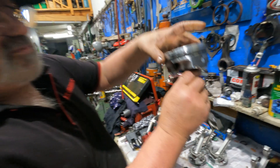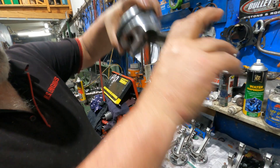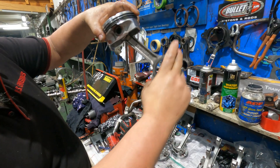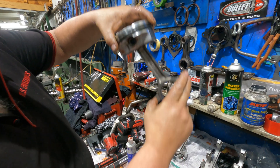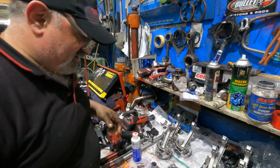I'm using a six inch, 125 thou long con rod. The idea is: when this is swinging around in the engine going up and down, if you've got a short rod, it's doing this - moving side to side a lot. Using a longer rod, it's doing this - it's not moving side to side as much.